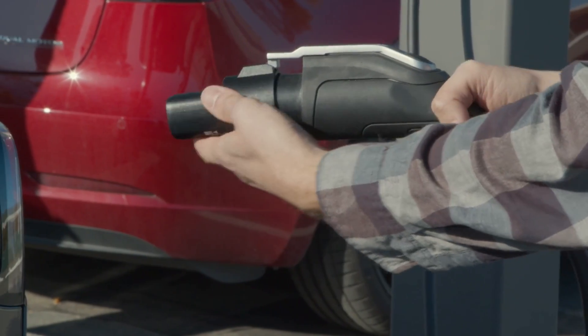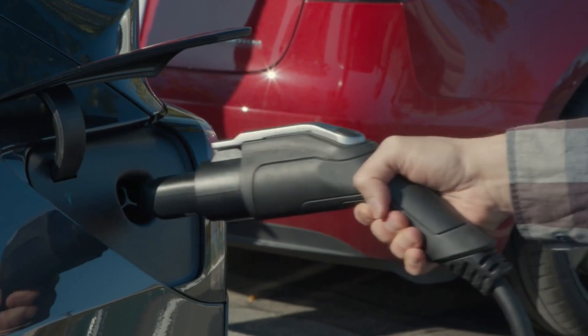The kit used to also come with the J1772 adapter, which is for all those Level 2 chargers you see at stores, hotels, and similar places. You need this adapter to use those chargers, but it no longer comes with the mobile connector kit — so you have to buy it separately. Make sure you get one of those. If budget is an issue and you have to pick only one, I would get the mobile connector. It's a great home charging option and gives you freedom and worry-free driving on road trips, especially if you think you'll need to charge somewhere other than Superchargers — like camping, RVs, or areas with no Superchargers. If you have a bigger budget, I'd probably get both. $200 doesn't really break the bank. Some people have the wall connector and have never used a mobile connector, so not everyone needs it.